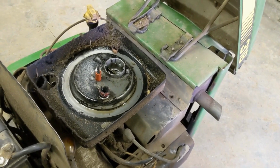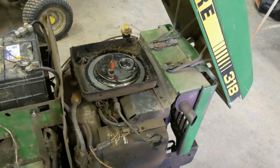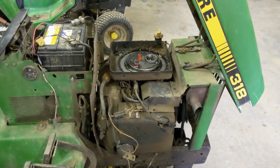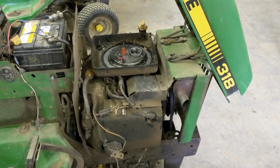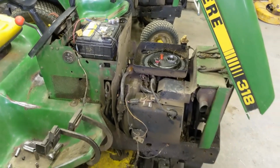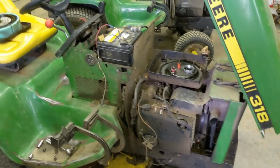So he's had it apart a couple different times here and there, and I convinced him that it has the dreaded Onan surge because the intake manifold is leaking. So that's what I'm working on right now, just taking everything apart to get the intake manifold off. I have the Onan in my 782 torn apart to reseal the intake manifold as well, so I figured this one should be a piece of cake to take apart. And then hopefully once we split that intake manifold and reseal it, we'll never have any issues with it again, because it's definitely a pain. A lot of people don't know that on these Onans, but I'd say probably 4 out of 5 times if you have a surge, it's because of the intake manifold leaking and not because of a dirty carburetor.